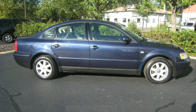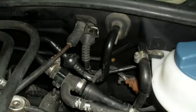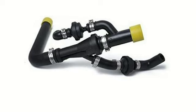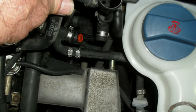And then when he was ready to leave, went to start the car, dang thing just running like crap. And I'm thinking, what could it be? I didn't do anything. I just touched this little vacuum leak. So we lifted the hood. We're looking for obvious stuff. I show him, all I did was touch right here. Well, he reaches in there and touches around and snaps this one big vacuum check valve assembly. And then a huge vacuum leak occurs and the thing starts running really rough.